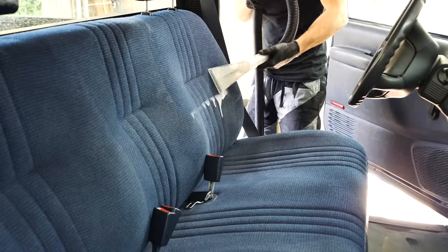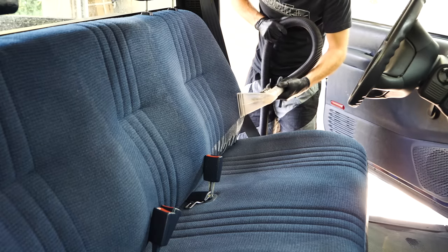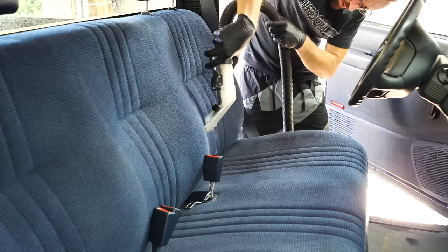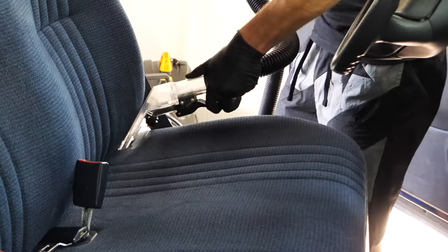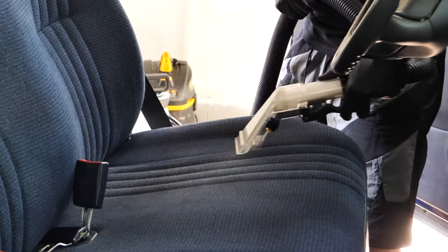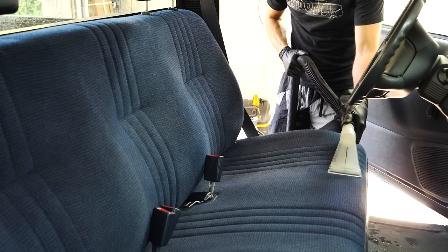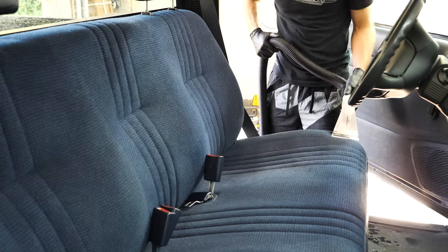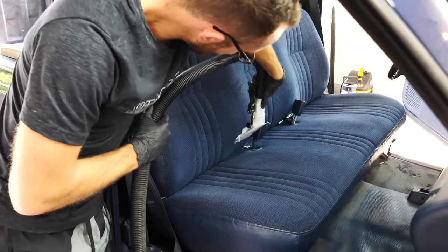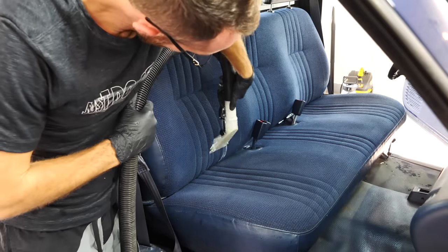Along with the BioBreak, I'm using in my extractor not only hot water but also something called FlexIce. It's a post-rinse that helps neutralize the pH of the BioBreak. Using the pair of them together is probably the best carpet cleaning solution I use — it keeps it low-foaming and does a really good job cleaning up the carpets with typically one to two passes compared to other products. It's hard to see in some of these shots because of the low light, but certain parts of the seats are a darker blue, and once they're extracted the blue of the interior is really starting to come to life.